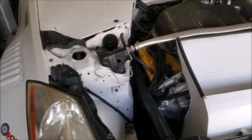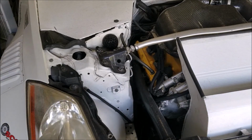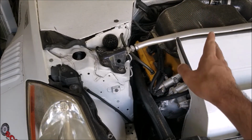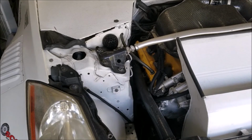You'll put the power steering rack back together. You can button everything up. You can get fittings to block it off. You can weld it up, whatever you want to do to block off the holes, and just slather everything in grease to make sure that it's lubricated because it won't have the fluid in it anymore. Put it back together and throw it in your car. That's all there is to it. You don't have to do anything to the steering wheel, anything to the steering column. Inner and outer tie rod ends are exactly the same. The only thing you're doing is getting rid of that disc, the fluid, and then removing all of the lines.